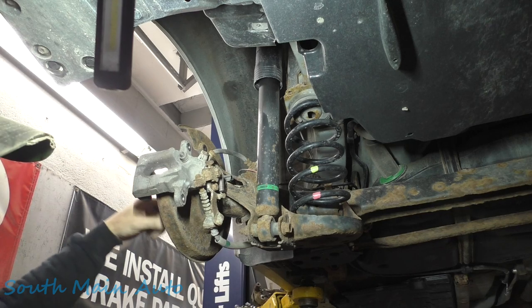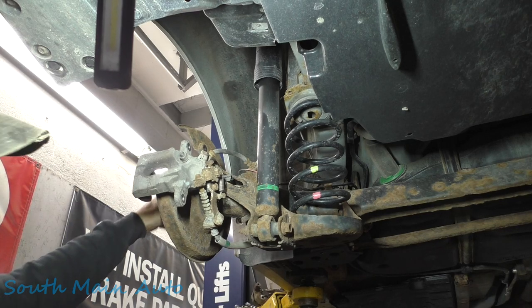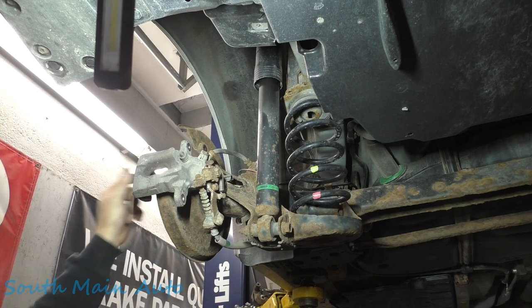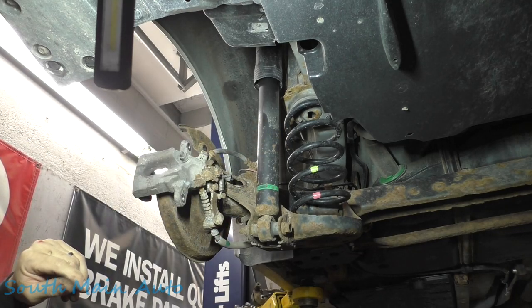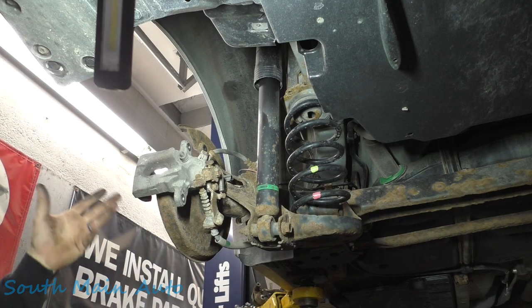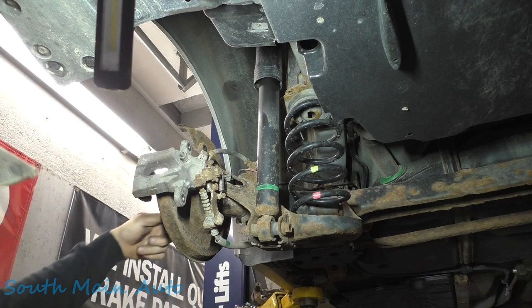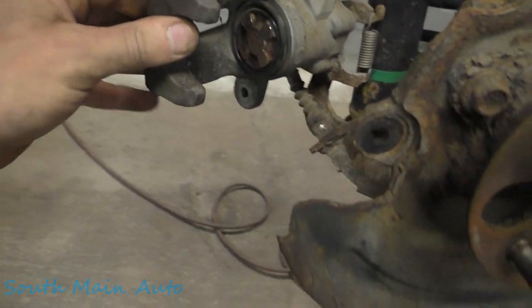on account of the noise that they're making. Of course, this one's junk. The speed sensor tip is probably broke off. That one over there, you guys heard that one. That sucker's pretty noisy too. It's up to them. Pay me now or pay me later, I guess. So caliper's good. Parking brakes seem to work.